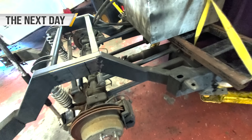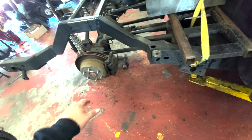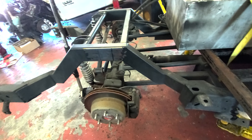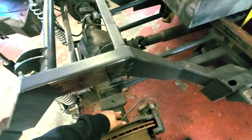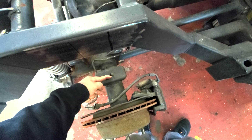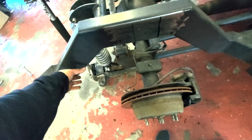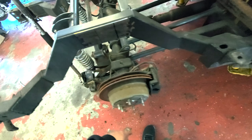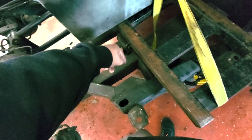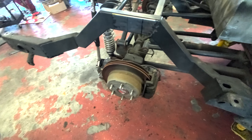Today we're going to take everything out so we can pull those axles out and measure them, and once we measure it we'll be able to order the new axles four inches shorter than what I already had. Once we do that we can slap them back on. We're going to cut the rear end before that — cut this off and cut it down four inches this way, and put the caliper on the back side because the back side has more room. I'm going to clean this up just so we can make it to LST, and after LST we'll come back and cut this off. We might even do that now but I don't want to rush anything and have problems in the end.